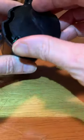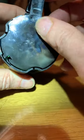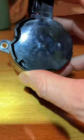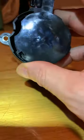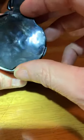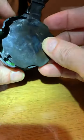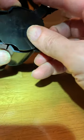This whole switch assembly is fairly easy to open up, so I'll go over this really quick. The light you're seeing is just my headlamp — I don't have adequate lighting; this is the first time I'm doing it with a cell phone. Hopefully this helps people out of a quick bind, especially those with basic mechanical skills. This pops off fairly easy. You can see the clips — I used a couple of small screwdrivers, popped one at a time, and was able to unseat and pop this cover off.